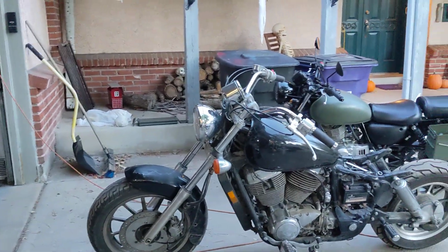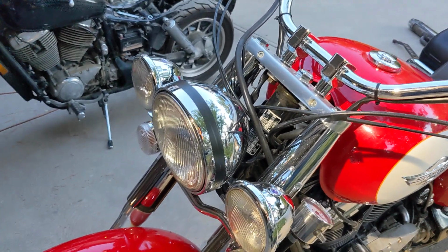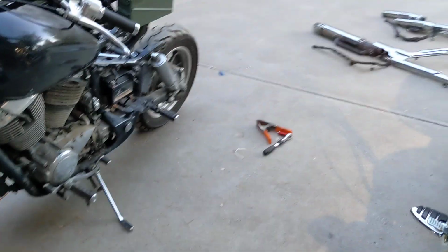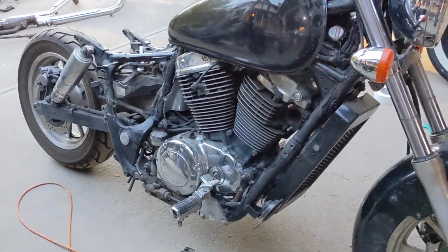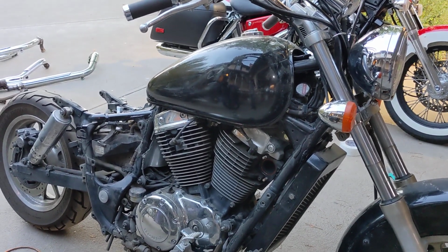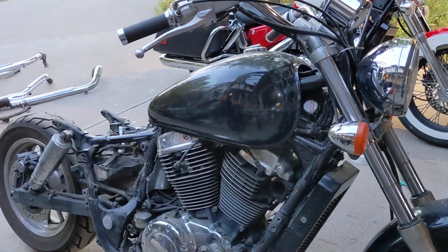The headlight bracket at the front is the same. Forks are the same. I've since put covers on and changed the headlight mount. The biggest difference between the Tourer and the Ace and the Aero is that internally the Tourer is more like a Sabre and a later 1100 with the twin pin crank. So make it louder and it sounds worse, as opposed to make it louder and it sounds better. But yeah, they're so the same.